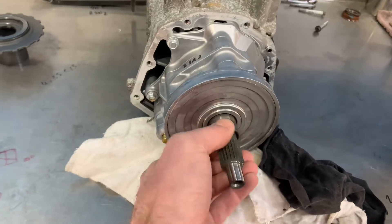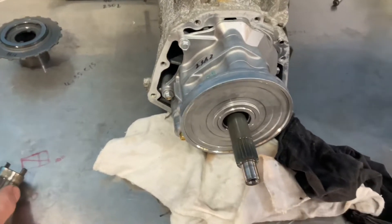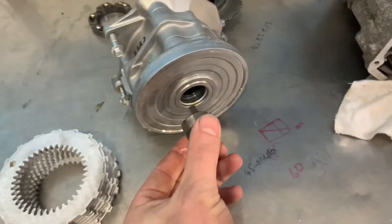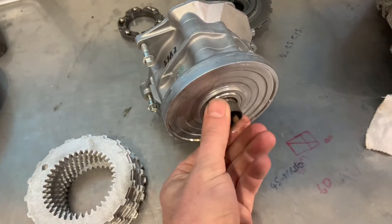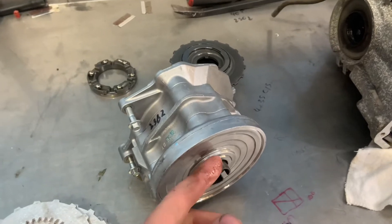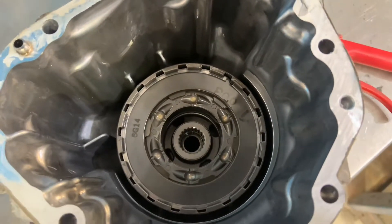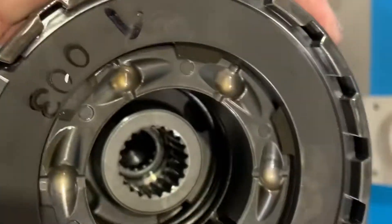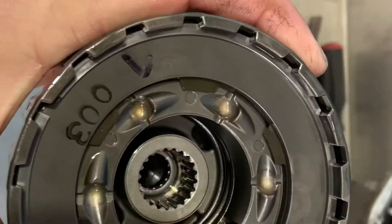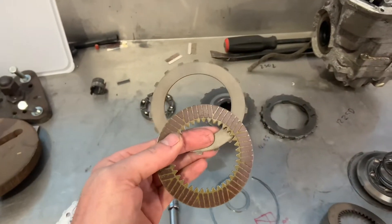This is the dual pump — we remove this part and throw it in the bin. There's one more piece: this little drive pin that goes in the input shaft, which runs the back side of the pump, and that other collar runs the front side — that's why it's called a dual pump. All it does is sense a speed difference between the back and front input shaft side into the pump, and apply pressure on this servo which locks all that clutch pack together. This is your clutch pack and hub — it contains friction plates and solid steel plates, works exactly the same as a clutch in a motorbike engine with multiple small plates.